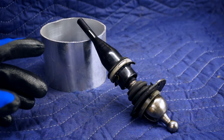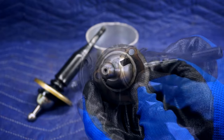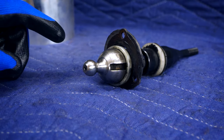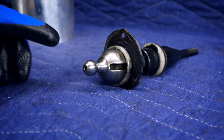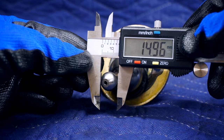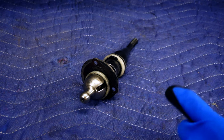One of the many things I didn't know was that there are two versions of the six-speed shifter, and they can be identified depending on the year and VIN of the Miata it came out of. Since this shifter came with the six-speed transmission I bought used, I had neither of those details. So I contacted 5x Racing and they said the surefire way of determining which shifter this is, is to measure this tip. If it's 15 millimeters, it's an older version; if it's 17, it's the modern version, which is the same as the tip on the five-speed shifter — which means I can reuse this bronze bushing. Let's go ahead and rebuild this with genuine Mazda parts.